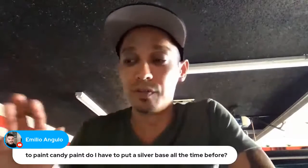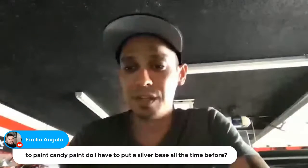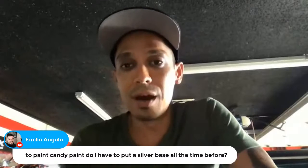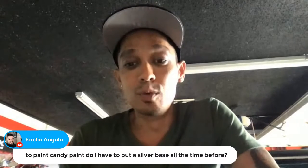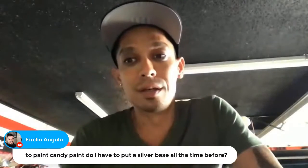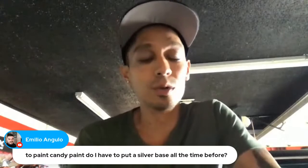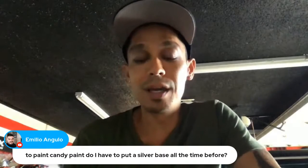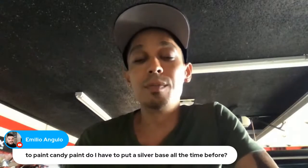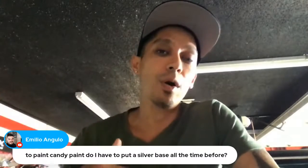That's awesome. There's over 250 hours of everything that we're talking about in VIP, step-by-step videos on how to lay down candy paint, just like Emilio said here. And if you're a beginner, it's recommended by me, say you're doing a red candy, to spray a red base coat and then put your red candy on it. It'll still look beautiful. It might come out a little tinge darker than going over a silver, but it's going to be much easier for you to lay down and spray than going over a silver.